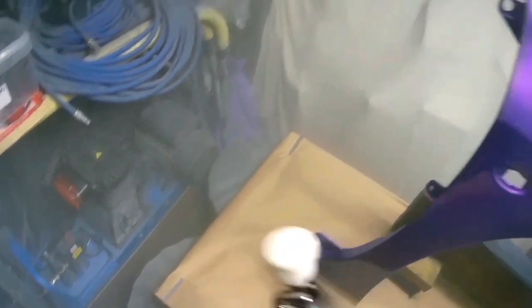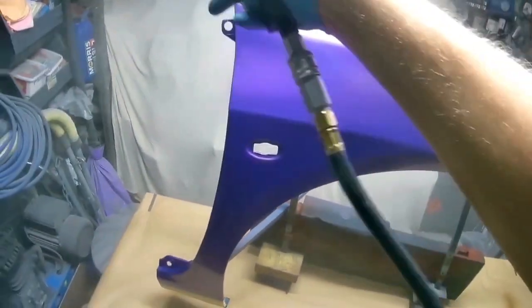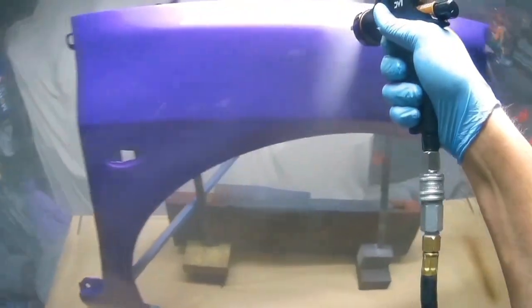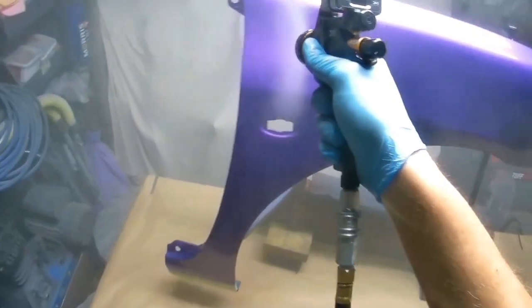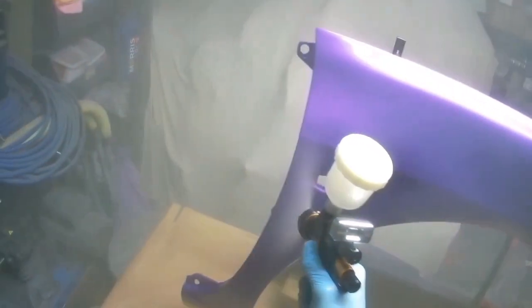After a couple of days standing around and the temperature warming up a bit it was absolutely fine, so it was definitely the hardener. I've used it in the summer and it's ideal - the fast hardener with this acts more like a normal. We had temperatures up to 40 degrees Celsius one day in the UK and it was actually perfect. Definitely if you're doing anything and it's remotely chilly, get yourself the extra fast, not the fast hardener - just jump up a step. Polishing window was really really good - a couple of days depending on the hardener and temperatures.